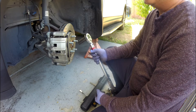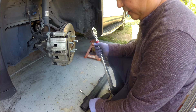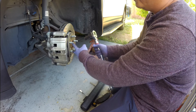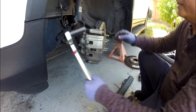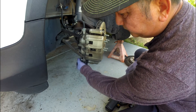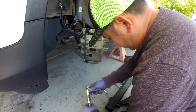That's basically it. If you over-tighten, I would say this probably handles up to 100 foot-pounds already — because it's a 19mm bolt, it handles a lot. Almost the same size as this one here, and this is about 90 to 94 foot-pounds. You can do over 110 and it's still not breakable. So just make sure you're tight enough. You hear that click? That means tight. The one right here is 25 foot-pounds only — that's 25 foot-pounds, and that's the number 17.